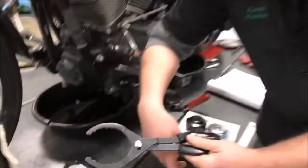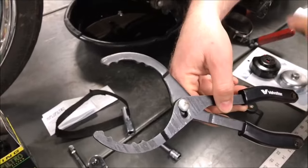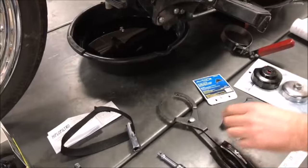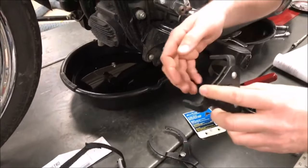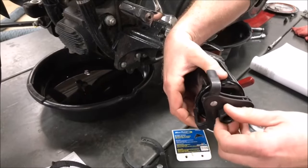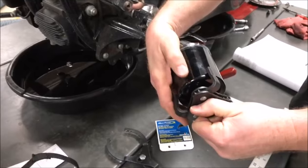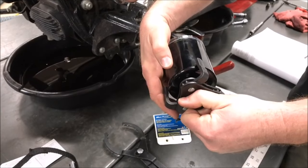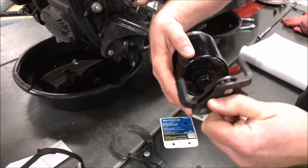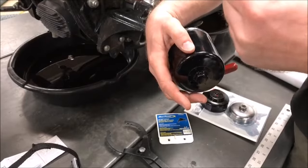How many people have seen oil filter pliers? They're handy at times, but in this case it won't work because the engine is too close. Another one that doesn't work here is the blue-point style — when you tighten or loosen it, it grabs way up at the top of the filter. I said that's probably not ideal. I used that one for a long time in my career, and then I got introduced to my favorite.